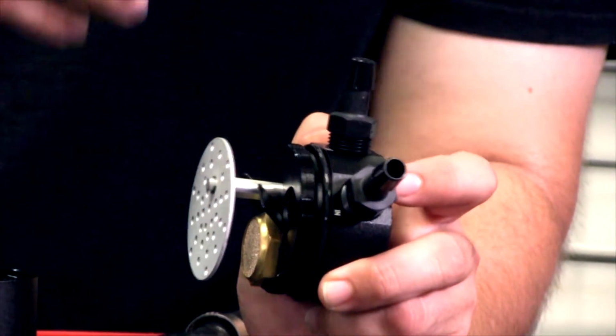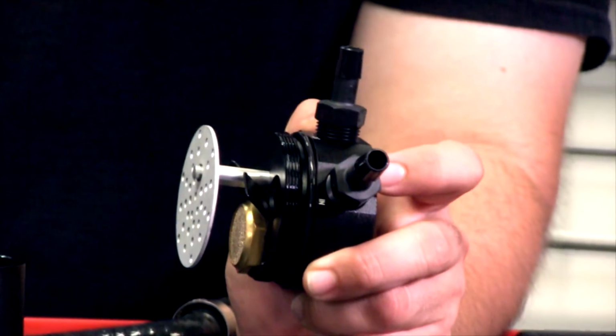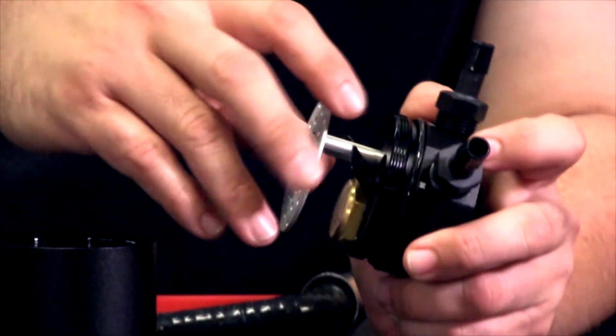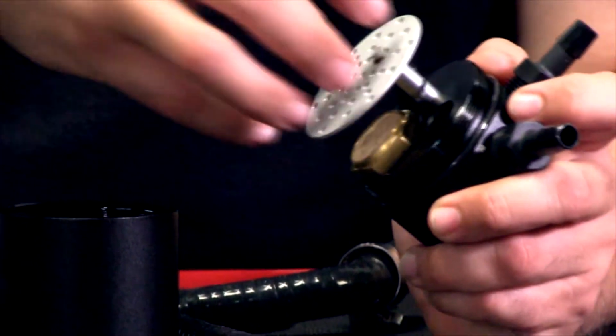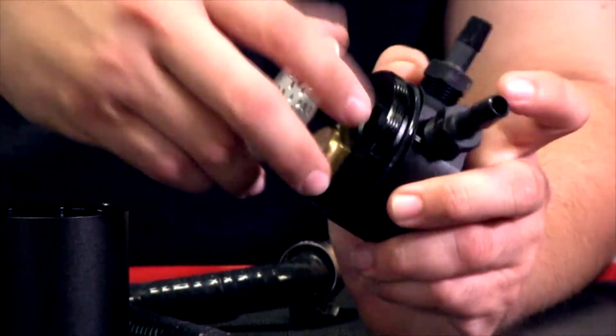So it's different from some of your typical catch cans that you guys will see on the market as far as the different ones that are available. But this is the baffle system, so it works using a various amount of doors and plates to redirect the air and oil to make sure it's all cleaned out.